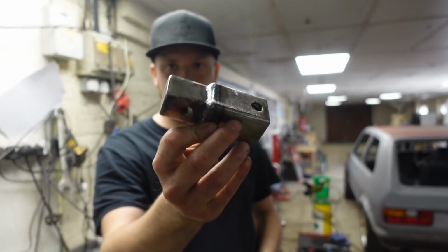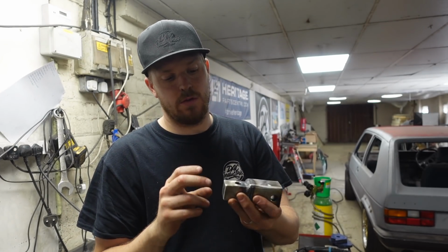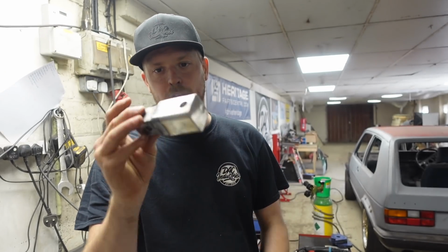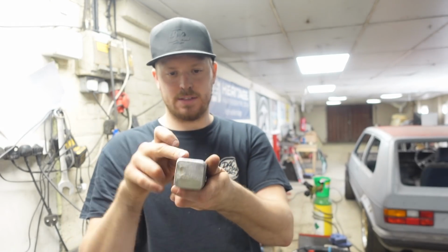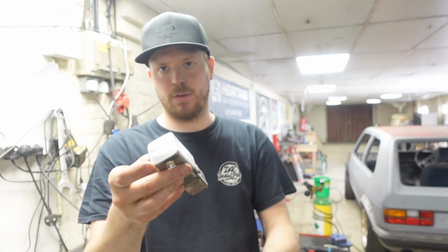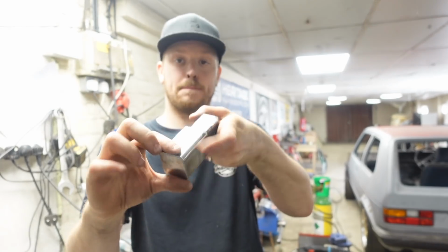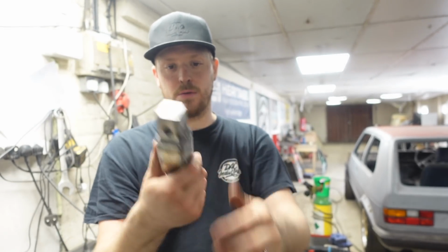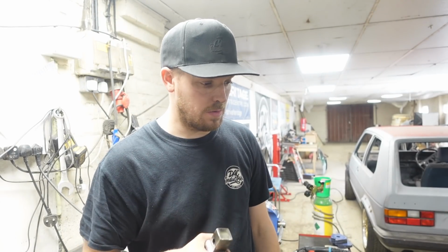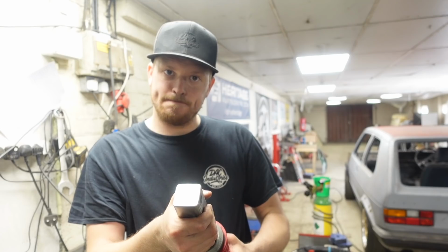And there we have one rear shock mount welded up. It's absolutely solid. So you've got 2mm wall 30x30 box inside, which has also then got a 2mm wall piece of tube to stop it squishing that way. That sits in, I think this is a 3mm 40x40 box, which has got 1.5mm on each edge. That's all welded together. Then the top, that's got the same walled tube going through the middle, plate the end, all welded together, and that is absolutely solid. So let's get that fitted onto the shock, get the shock fitted onto the bike, see if it'll hold its weight.